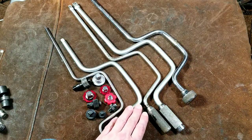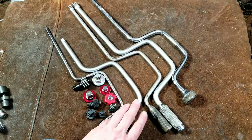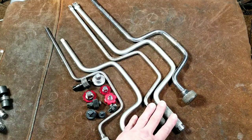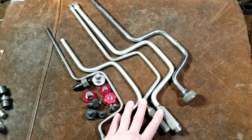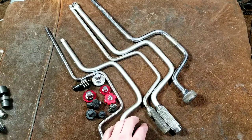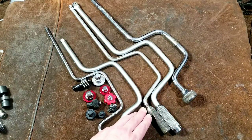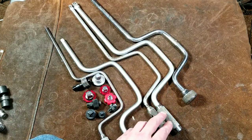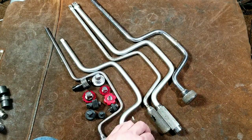Catus Maximus here again, this time with a review of speed handles or spinner wrenches, and thumb wheels or thumb spinners. The thumb spinners are more common, but speed wrenches are becoming less and less common for one obvious reason: they are just so long. The average speed wrench is about a foot and a half long. Nowadays with air tools and brushless cordless tools, you don't see them as often, but they used to be the answer for quick disassembly and especially assembly work — oil pans, valve cover gaskets, transmission filters — anywhere you have to run in several fasteners relatively quickly.